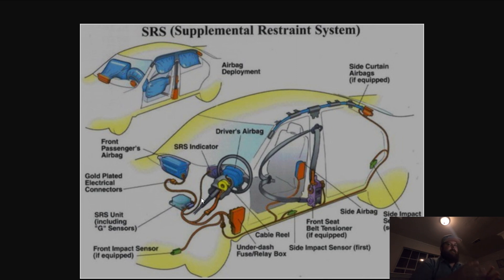That's why most SRS modules are in the center of the vehicle underneath the center console or something. Typically they're more toward the back in the center — that way, if your car gets all folded up, they can't get touched. They're hard to get to, so you can't mess with them. They also have a g-force sensor — that way, if you have a hard g-force but you don't make contact with any impact sensors, they can still deploy bags. There's also some sort of sensor that can determine whether or not the car is flipped over. So if you ever remove one, you've got to make sure the battery is disconnected and unplug it before you ever flip it over, or it could deploy all of the airbags thinking the car just rolled over.